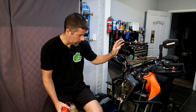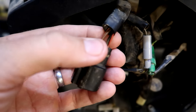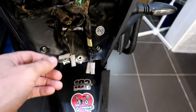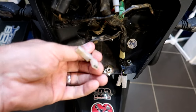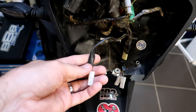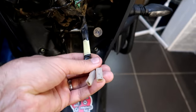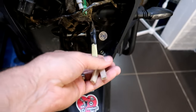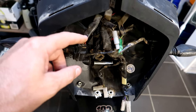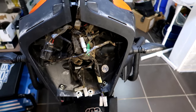You can see there the red and black wire. Once you pull out all the wiring on the 390, you'll find two sets of auxiliary plugs. One of these is powered constantly — even with the key off — so you want to check with a multimeter which one is which. I've put a bit of tape around the one that's only powered with the key on, so that's the accessory power one. We'll be wiring our auxiliary lights to that one, triggered by the high beam power through a relay.